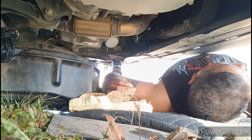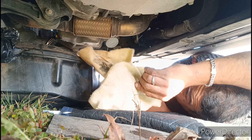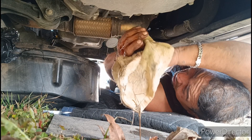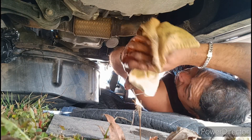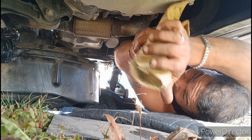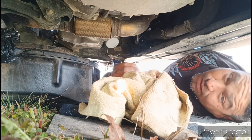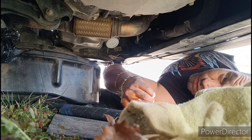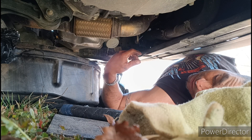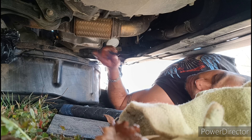It's just a bolt with a little washer in it — it's a special washer, you can't put any old washer. Whenever it starts leaking, if it ever does, sometimes this wears out. The little bolt is like four bucks at AutoZone or anywhere, dirt cheap. It's got a special little plastic shimmy — normally washers are made out of metal, but this one's plastic, so it wears out with the tightening and loosening.